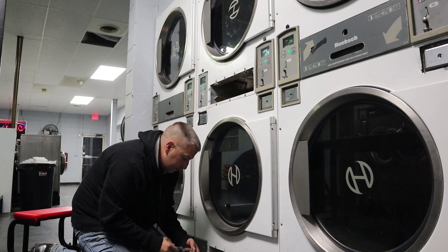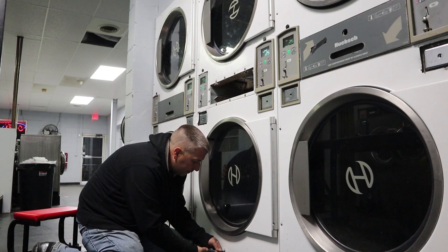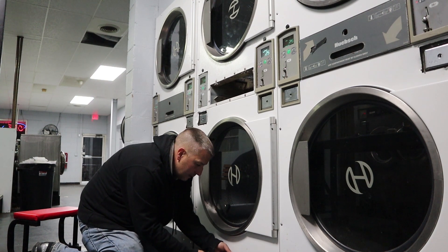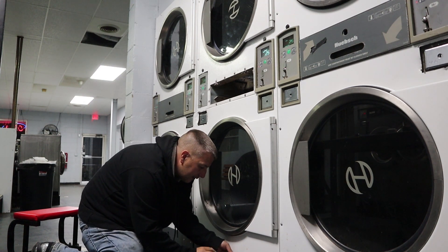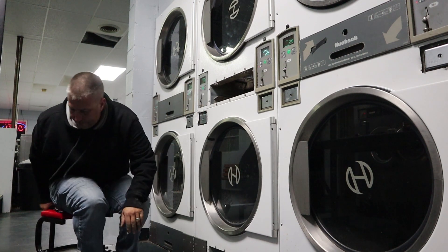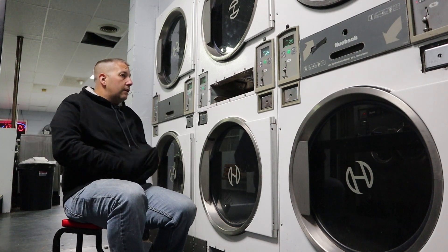You want to get into a maintenance routine. Clean your drains every so often on your big hard-mount machines — a couple times a month. The Horizons, if you buy them, you've got to clean those drains a couple times a month too. Check belts. If you just let this stuff run and hope it works, then fix it when it breaks, that's fine — but at some point a customer is going to get taken, and that's going to reflect on you. Ninety percent of the things I see wrong in laundromats you can anticipate.